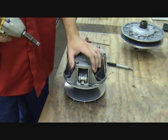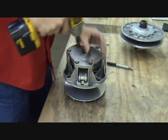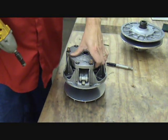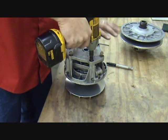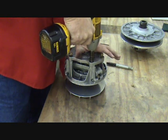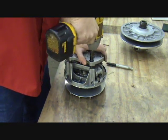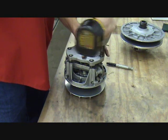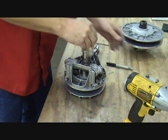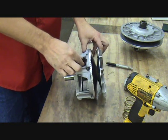When we reinstall the clutch on the machine, it needs to be torqued on correctly with a torque wrench. When you get down to the last couple of bolts, you need to kind of press down on it, otherwise the spring pressure is going to try and cock this cover up. There we go — there's our cover. Leave the bolts right in it. There's our primary spring, and now we have access to the fly weights in here.